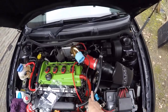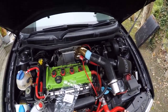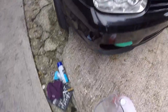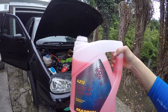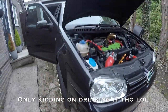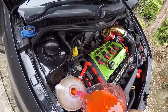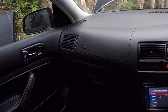There we go, it's in - plastic clip, give that a little wipe. Connect that up - that's clicked in nicely. Connect our battery up, connect our boost pipe - the charge pipe - bang that in there, fill the fluid, start it up, and then test it out. I'm using G12 coolant - I ran out of the original stuff but this should be good enough. Oh look at the color of that - you could drink that strawberry milkshake! No leaks yet.